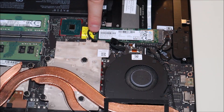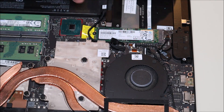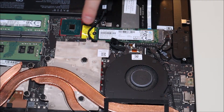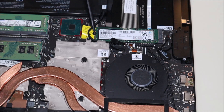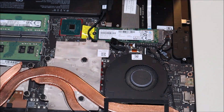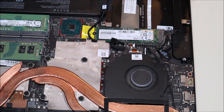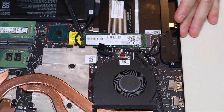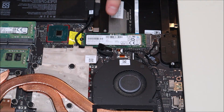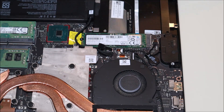This is your solid state drive, and that's the one screw holding it down. There's a notice on it saying 'power off before operation' — which we always do for any repair. Also, covering the screw that holds down my solid state drive, there's a warranty void sticker. You'll see them at various points — on the fans, sometimes on the CPU, even on the outside case. Razer is quite particular about that; I even have a warranty void sticker on my Wi-Fi card. If you need to get your solid state drive out, that's the screw right there — remove it, replace it, and I'll have information in the description about part numbers.